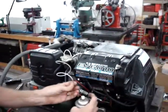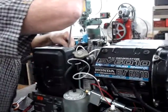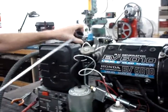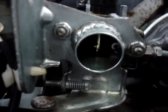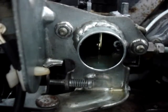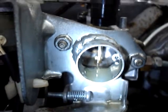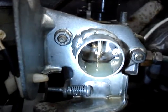You can hear it gurgling up through the emulsifier tube. If you can't hear it, you can take the intake hose off — which goes from the back of the airbox to the carburetor — and shine a camera or flashlight in through the end to see it foaming. Spray this in until you see or clearly hear it foaming out through the emulsifier tube, then let it sit for about 30 minutes.